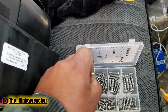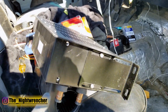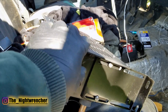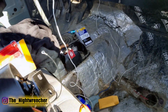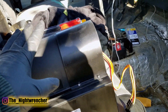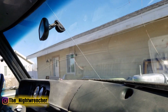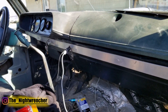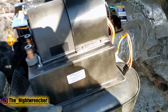I've got four bolts on each side of the housing and I can start measuring this out. I actually moved the heater over to a single hole and I'll add a support later to prevent the plastic trim from getting blown up. Instead of hiding it pointing at your feet — which actually would have looked pretty good — what really concerns me is the windshield fogging up, especially driving in snow. This dash has defrost vents on either side but no tubes connecting to them.